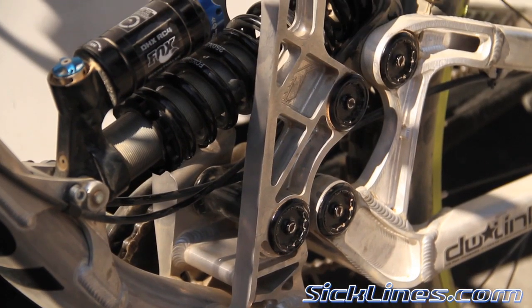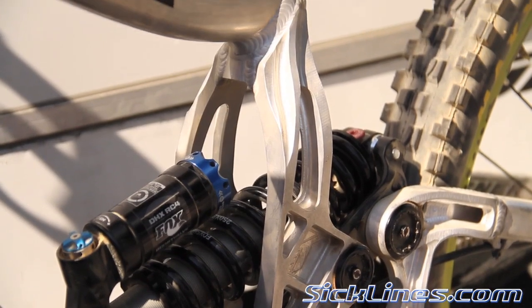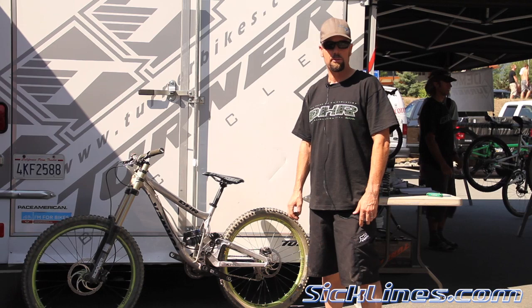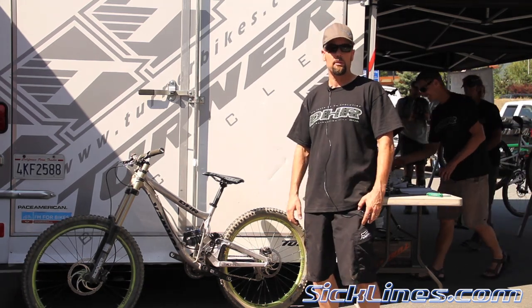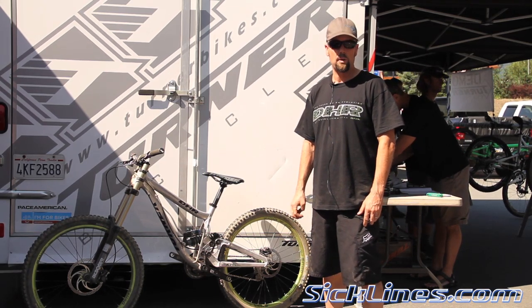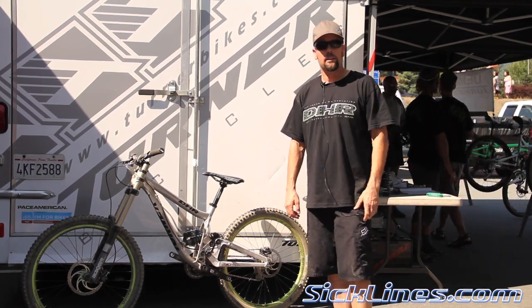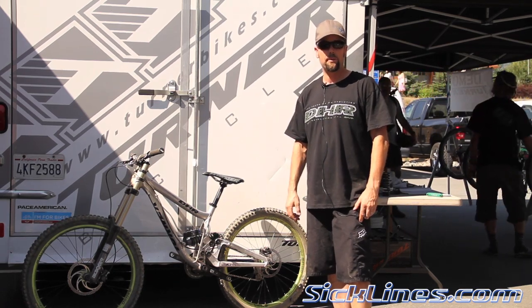Bottom bracket is just under 13.5 inches with 2.5s on it. Fork set at standard heights. Head angle is just over 63 degrees. Rips around the berms on A-line. It's unbelievable. People are amazed, and that's really great for me because obviously we've been sweating this thing a long time. So it's good to hear from real riders on a real mountain, not just internet pontificators flapping their keyboards at work.